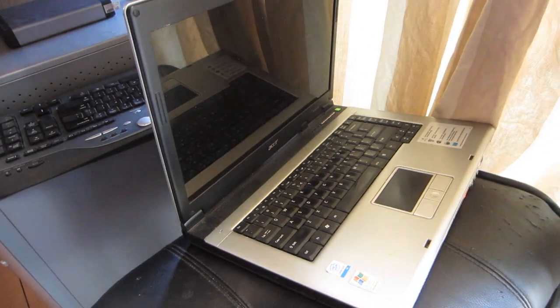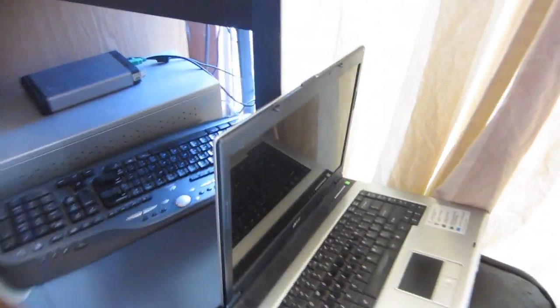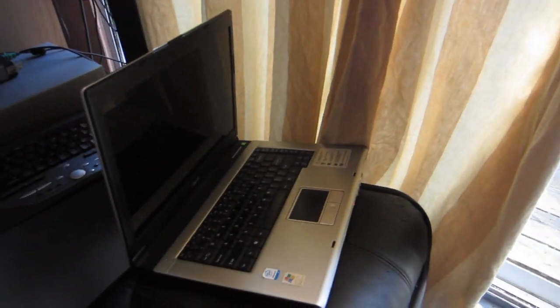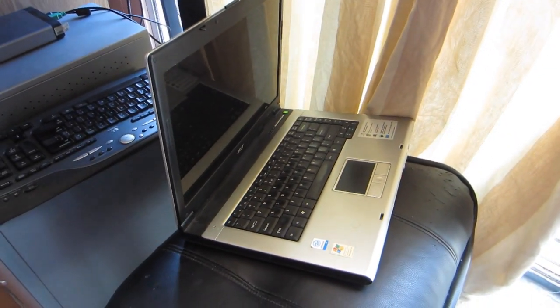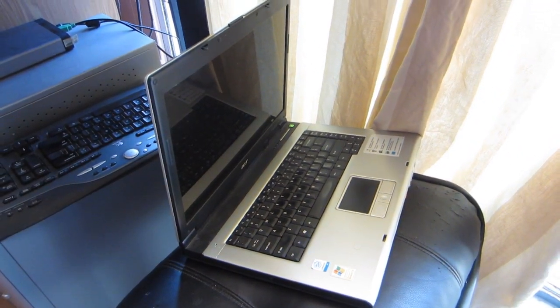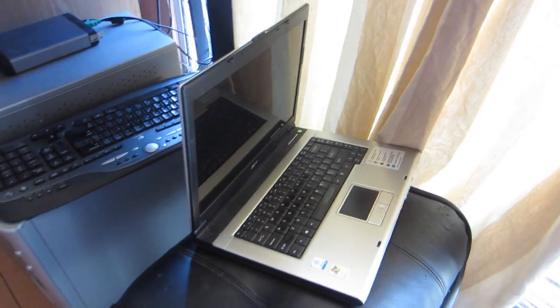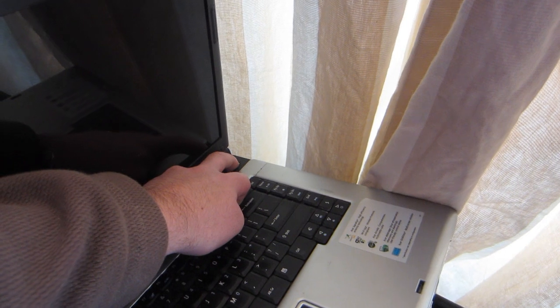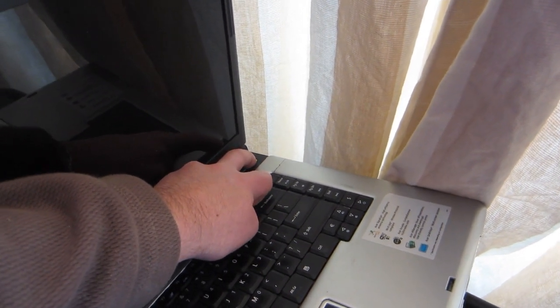No boot screen. Okay, it was having problems before. Sadly the problem is a little more extensive than I thought — it's not booting up. I hooked it up to an external monitor and the monitor is not coming on either. So I'm going to look around and see if I have a spare video card or some RAM I can swap around, because usually those are the culprits when stuff like this happens.